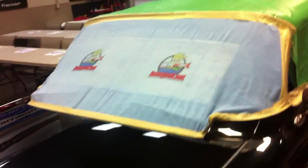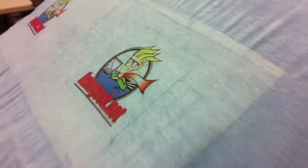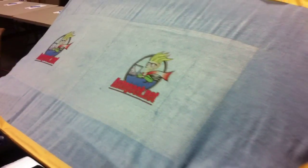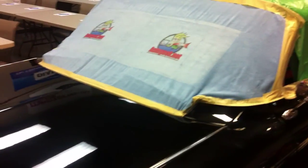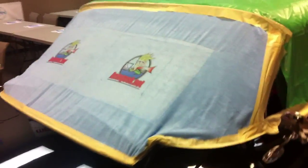The next thing I did was put down a microfiber windshield towel. I used to use beach towels, but AutoGeek brought this one out — it's real soft and won't scratch the paint in case you rub it against the paint when you're putting it on. I laid it across the windshield and taped it over, so it's real secure and it won't come off. When you're using a rotary buffer, it will often throw splatter that gets on the windshield and, more importantly, up on the wiper arms and inside the fresh air grill underneath — and once it gets inside there it's almost impossible to get out.